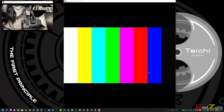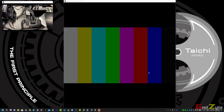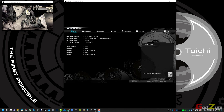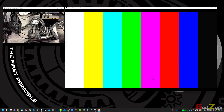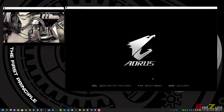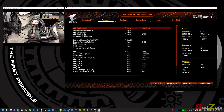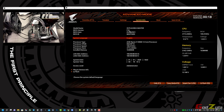Now once you've done all the flashback, it's time to test your components. I'm turning on my X570 ASRock Taichi — as you can see it booted up without a problem. This is actually the latest BIOS version on my Taichi. Now to test my Gigabyte Aorus Master — turning on the switch. As I've cleared CMOS on both motherboards, the ASRock Taichi and the Gigabyte Aorus, you should see a signal saying it's been reset. Checking the version — that's right, the version is up to date.